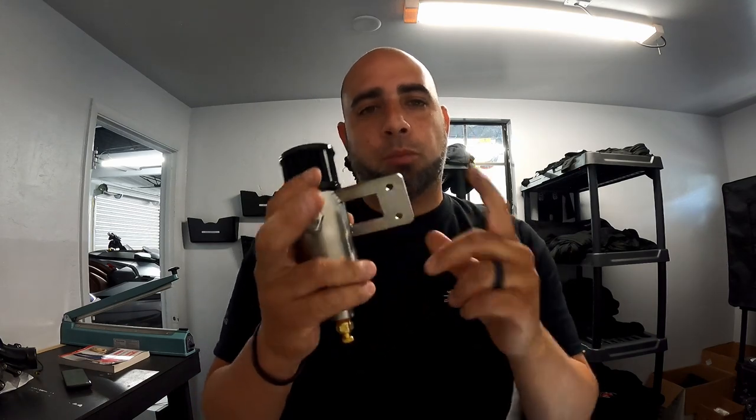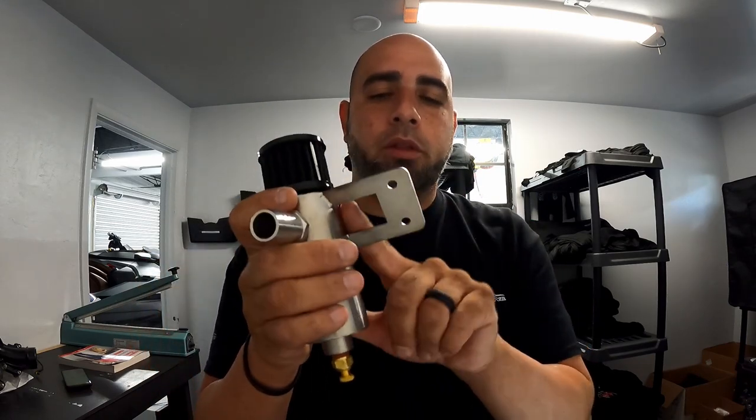So a couple things I want to touch on the cans. We had some issues in the beginning where this bracket was too long. Back then, those were made by a different person. Since then, we've taken basically the can over, and we've started making them ourselves. So normally this bracket is about this much longer. It was hitting all the newer skis up in the front, the airbox. So we took that out, redid our bracket, obviously made it shorter.